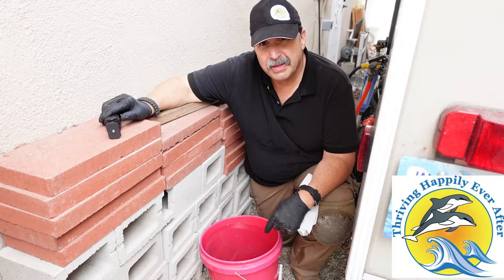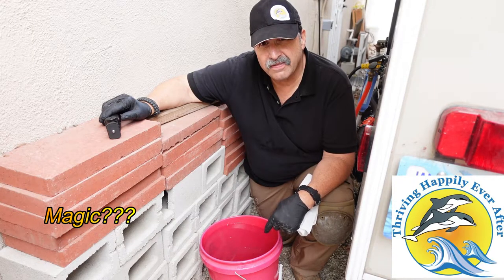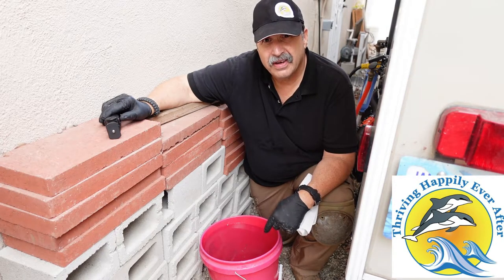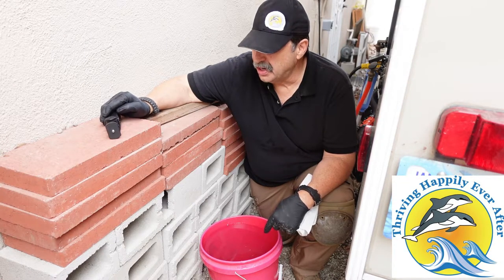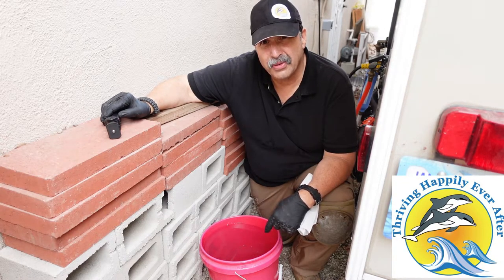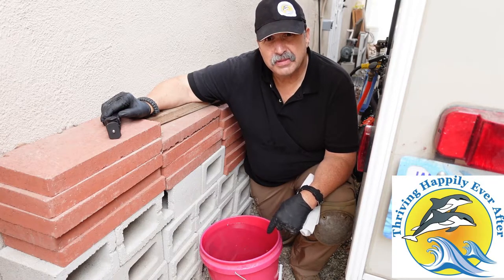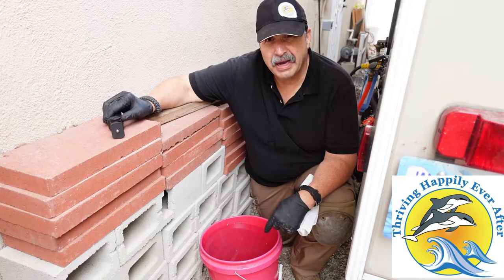That's kind of where the magic happens. It seems like most of the stuff is getting caught towards the lower half of the black tank, so we've always been able to catch it and get zeroed out on our tank just doing that. So what I'm going to do now is run for a minute and a half on several cycles — three or four cycles — because I want to really do a super big cleaning on this. A minute and a half times three or four cycles — I'll let you know when I'm done.